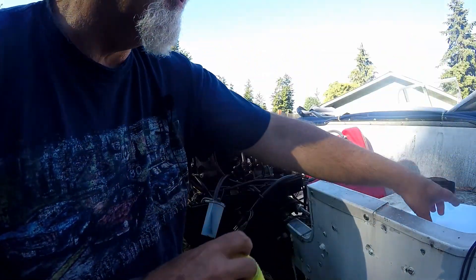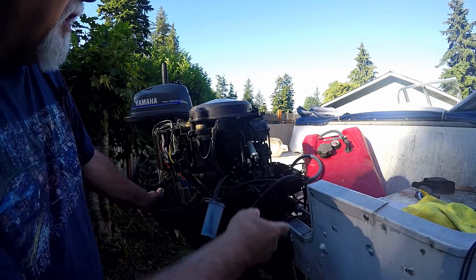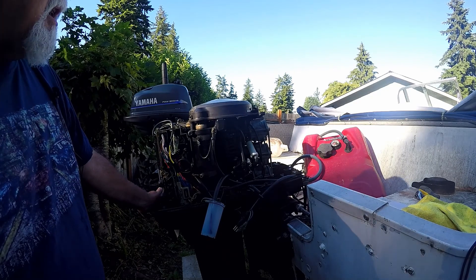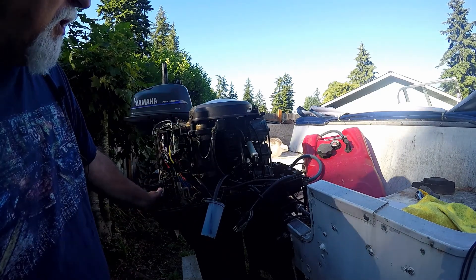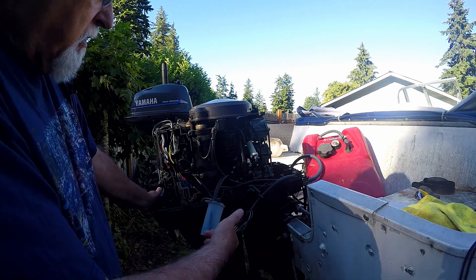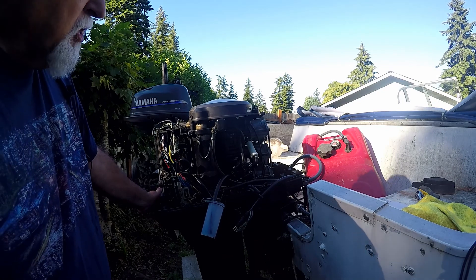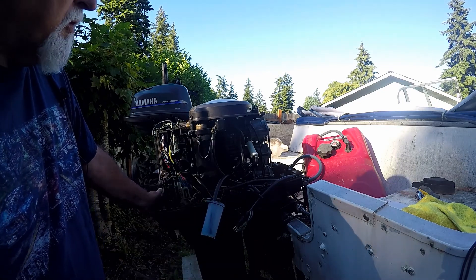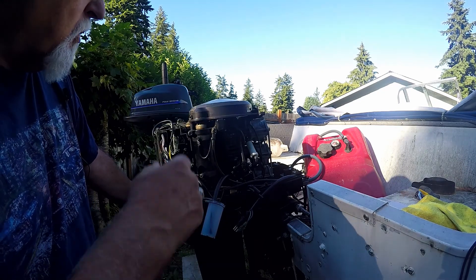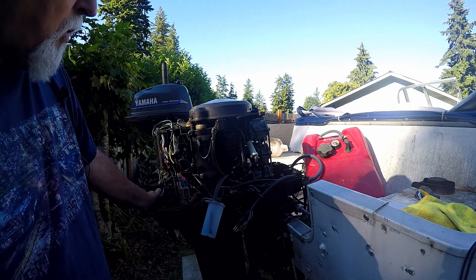For output for oil injection, we'll turn the motor on at 1500 RPM and fill the cup. I got the auxiliary tank hooked up with 50 to 1, going directly into the motor, since we're taking the oil injection and going into the cup and not into the fuel mix. So we'll be okay running for 10 minutes with 50 to 1 fuel going through the motor. I'm going to put it in a barrel so we don't waste water.